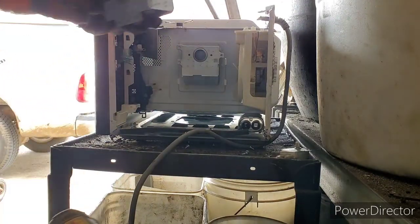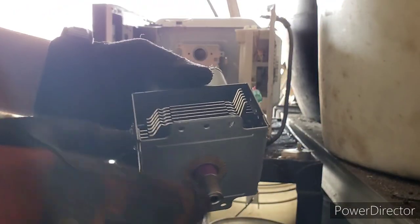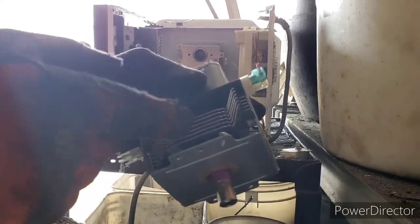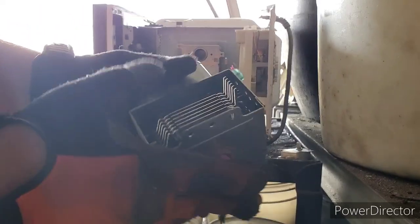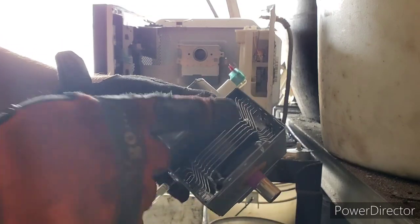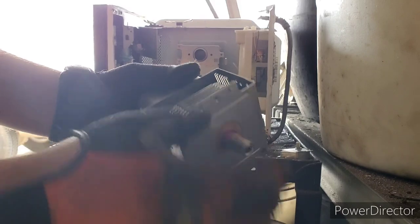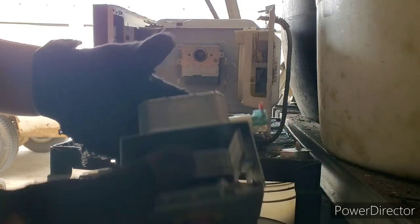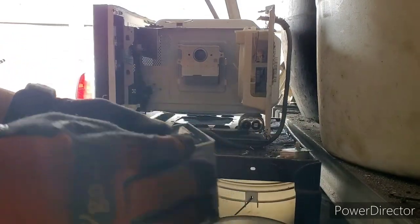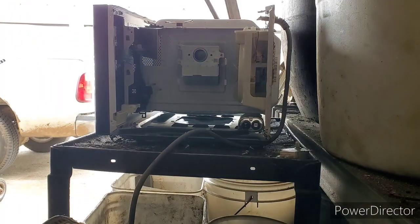To go over the magnetron: there is some copper wire in here. You've got to be careful when you strip these because some of them do have beryllium in there and you don't want to inhale that. These have aluminum fins and then there is a copper core in the actual piece and a little brass ring. Good to strip out if you know what you're doing — I'll do a video on how to scrap these out down the road.